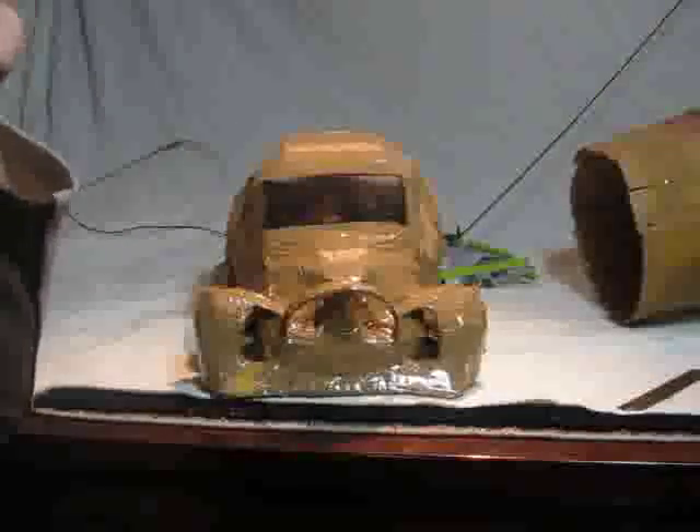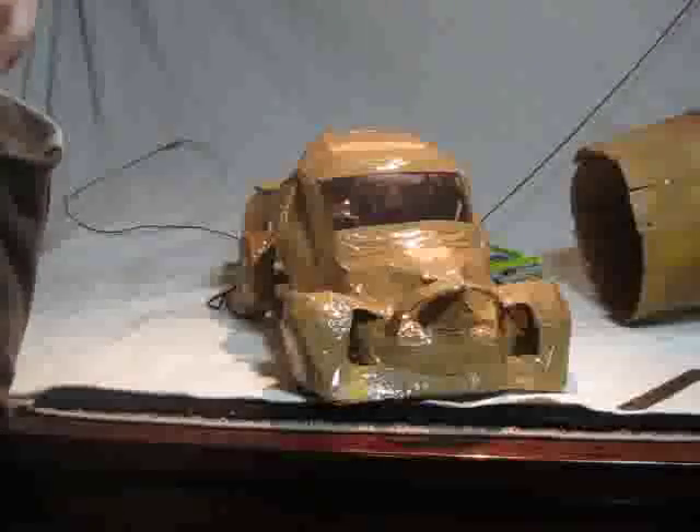There are strict targets we're trying to achieve: drivetrain efficiency of 80%, which can be done with a traditional combustion engine drivetrain — gearbox and back axle between 5 and 7%. For the electric motor we found one from a company called Emrax from Slovenia — the Emrax motor is 94% efficient. It's an outrunner based on a German LRK torque-max design. They've got a 12-kilo electric motor that can do 80 kilowatts peak — just stunning. It can only do that for about 2 or 3 minutes before it overheats. It's designed for light aircraft to get gliders into the air.